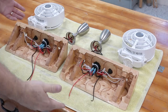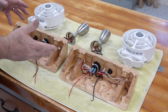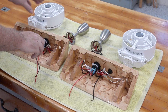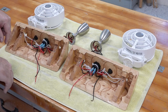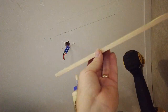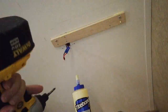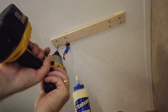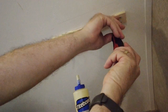The goal is to put the screws through up tight to the ceiling, then mount the fan and light over top so you won't see any screws — it'll be held up seamlessly. Here I'm attaching an extra thick piece of maple to the ceiling because I didn't think attaching to just the thin plywood was enough, so I'm adding 5/16-inch thick maple to the ceiling and screwing through both, which should definitely make it strong enough to hold the weight of the device with the fans and lights.